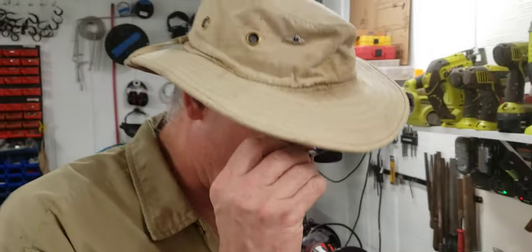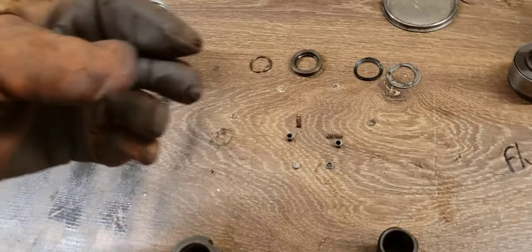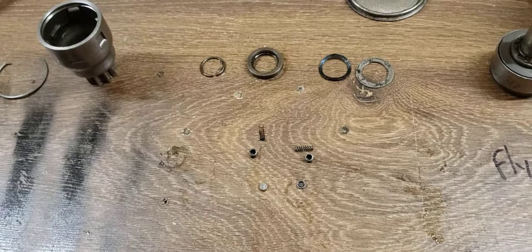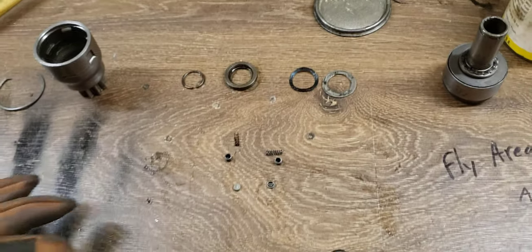They're a huge pain in the butt. We're doing another video about how to more easily correct this, but this is an in-depth look at a ratcheting starter. So a ratcheting starter — the Bendix will pop down on you, and without high RPMs it's not going to come back. So we're going to show you how that actually works.